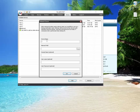Device name, Buffalo Backup. You can make it something else, but I'm just doing that for our demonstration here. All right, so we named the path Buffalo Backup and backups. Backups is the name of the share. This backslash, and then this is the NAS name, which we named, and then this is the share backups. So that's what we call a UNC path. Okay, we're going to use the username backups and the password that we set, and hit OK.